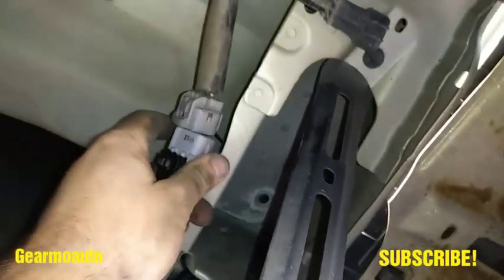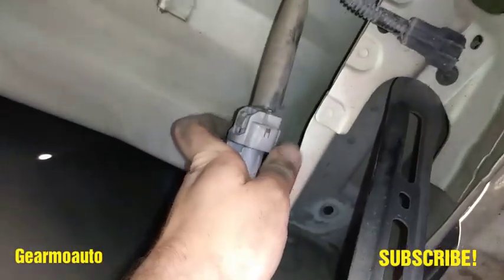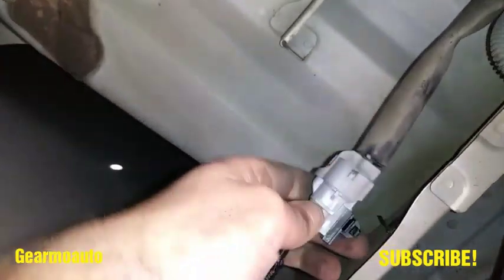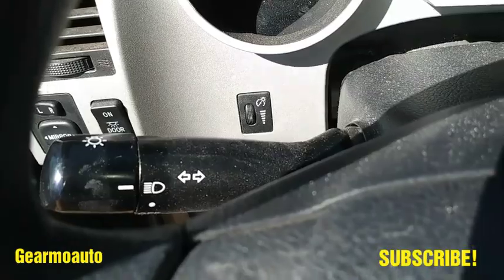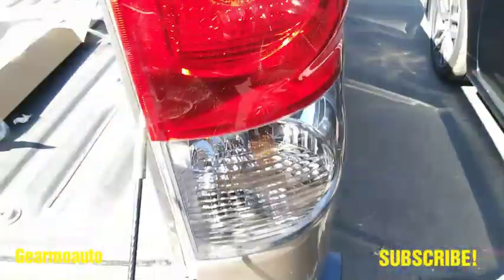You don't have to get them mega tight, just get them tight, and then maybe a quarter turn more. And then just connect this down here to this connector, get this connected, and then make sure you have all your guides that are attached to the harness plugged in to the vehicle. There's these little guides that go in those little holes to hold the wire harness so it's not flapping around. Alright, now we're going to just turn the key. Let's turn the lights on and just check it, make sure all the lights work. I would do that if I were you. It's real sunny out here, so it's kind of hard for me to see.